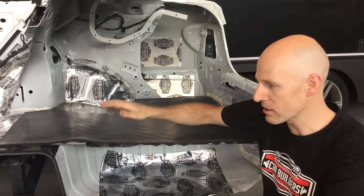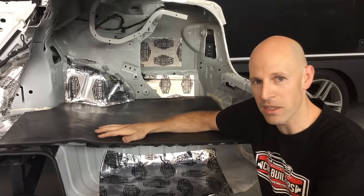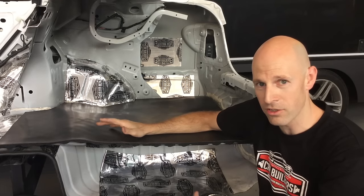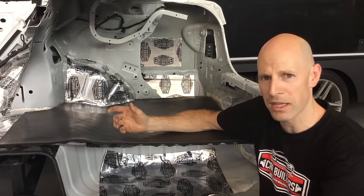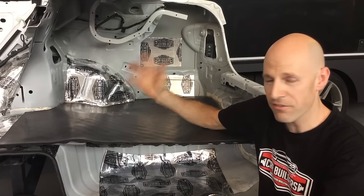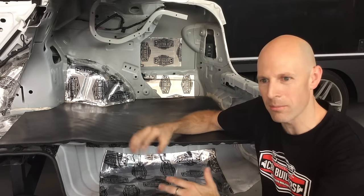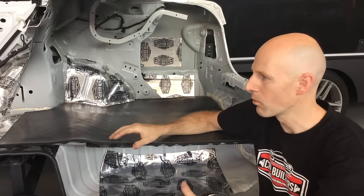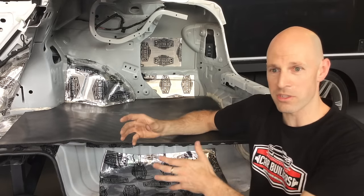Considering the weight — this one is four kilograms per square metre — it's not something you use in a vertical application. It is a little bit impractical when you try and hang it as a curtain; you do need mechanical fasteners. I have seen people use it behind door trims, but it's not so practical and it makes the install a little bit challenging. Where a lot of your noise in your doors is usually going to be on the sheet metal skins.